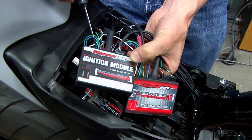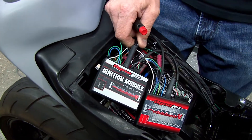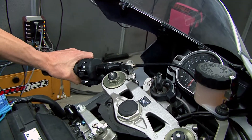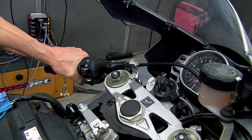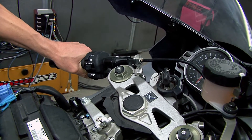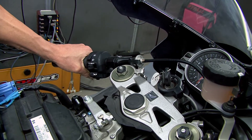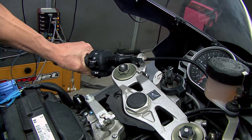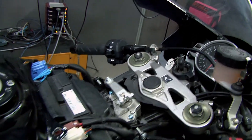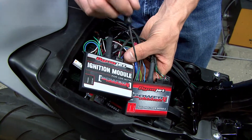Then on the ignition module we have one more wire. This is wired into our clutch switch — up here at the handlebar most bikes have a two pin connector — and you connect that to the grounding side of it. We can set the RPM to anything we want, so during a start, let's say you want it to only rev to 6000 RPMs. As soon as you release the clutch it will go to full RPM. And the last wire of course is the white wire for the crank data.